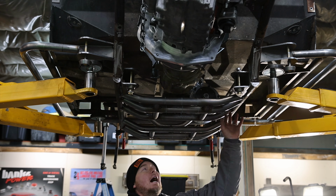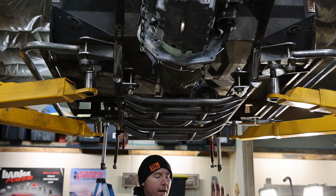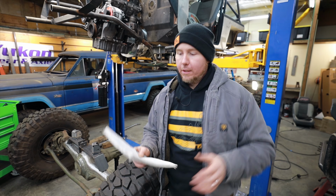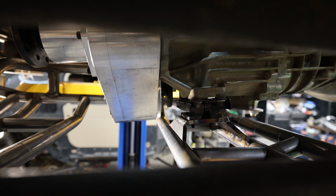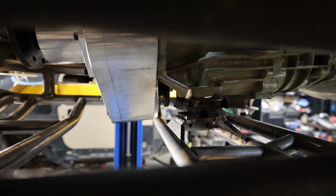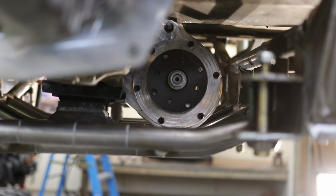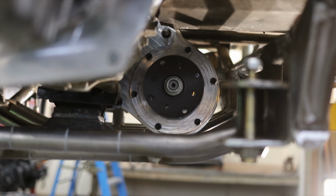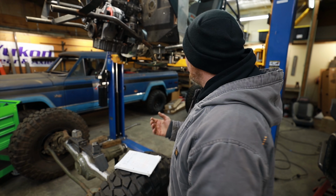And because of that, I designed it to where we have like 3 cross members that are all tied together in multiple ways. And a lot of people don't know, tube is really slippery actually off-road. So I didn't want to have to do like a big skid plate. I would rather do tube because from a structural standpoint, I think that it's going to be a lot stronger for a lot longer.